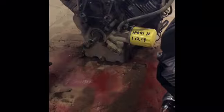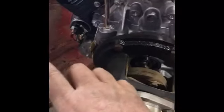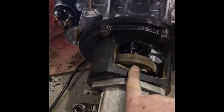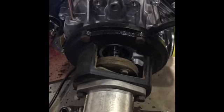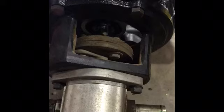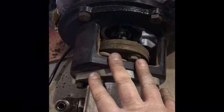You're going to have to reuse the keyway from your old engine on your new engine. After the pump is totally off, take the keyway off the old engine and install it in the keyway slot on the new engine — make sure it's clean and free from any oil, and that includes the crankshaft. Then slide the whole pump and housing piece back onto your new engine.